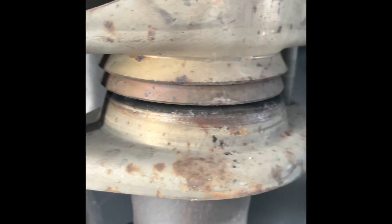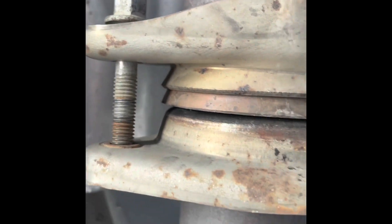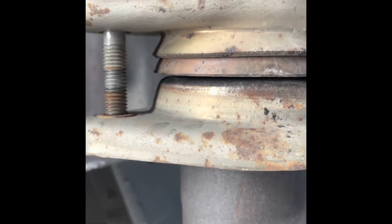We're just about ready — got the exhaust in. There are just two bolts there, and then we tighten that one up with some hangers. I took it out in two pieces. They do want you to cut it, but I don't like cutting my stock stuff. I have the aftermarket one in two pieces as well. Going to tighten these up and we'll go for our test run.